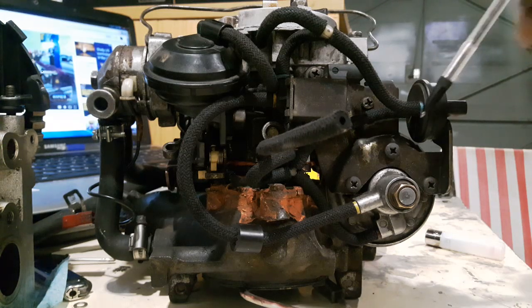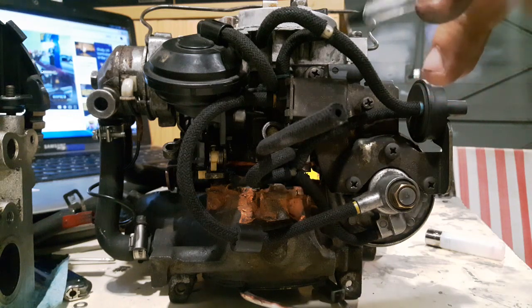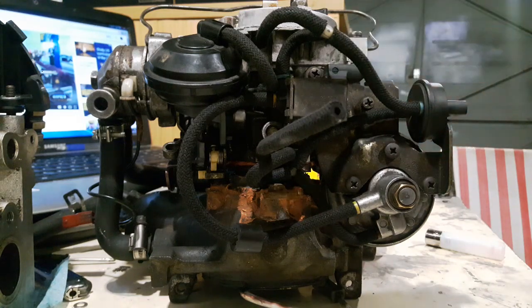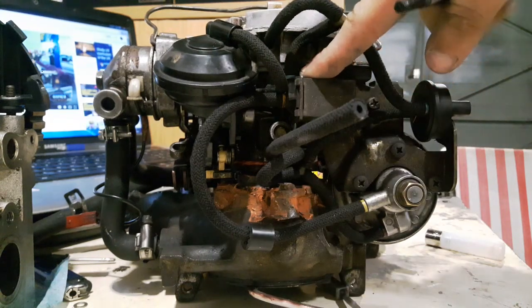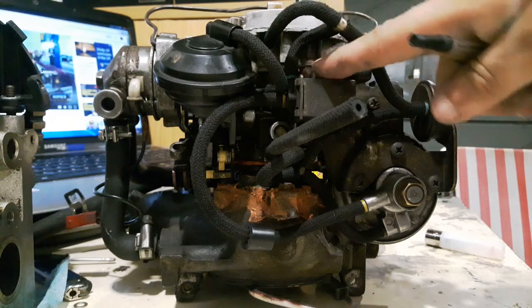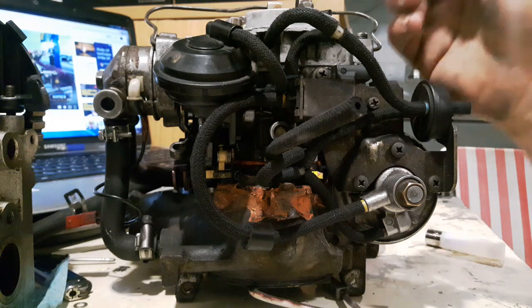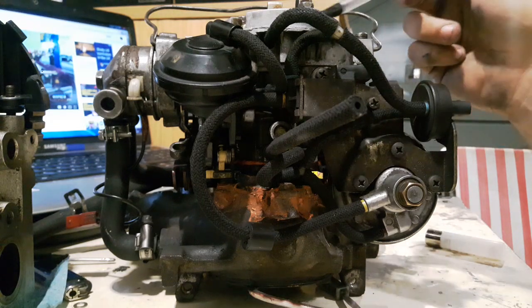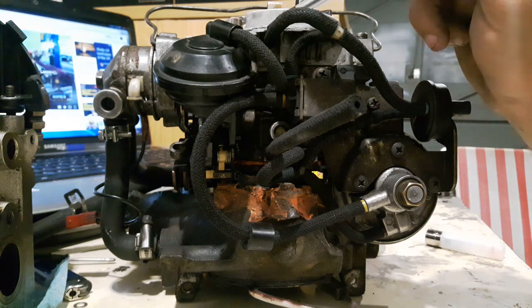From the TTV, you'll go up to a T-piece. Then the T-piece will go off forwards, towards the front of the carburetor and down into this blue port on the top of the overrun cut-off solenoid. And then coming back onto that T-piece, you've got this final line that goes out to fresh air. So that is the basic layout of these vac hoses.